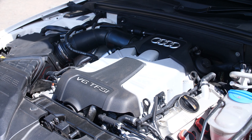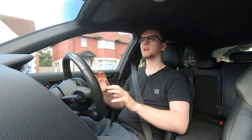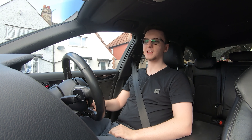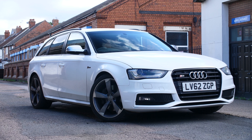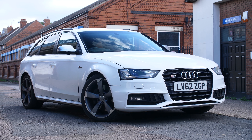That means that this car is rapid. You get 330 horsepower as stock, although if you're a bit more adventurous you can tune it — Stage 1, just ECU remap software only — to 420. Then if you feel even more adventurous and fancy changing the supercharger pulley, you can get to 480. As for the moment though, this car is entirely stock: stock brakes, stock power, stock suspension.